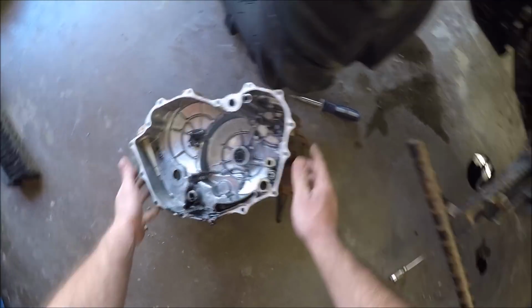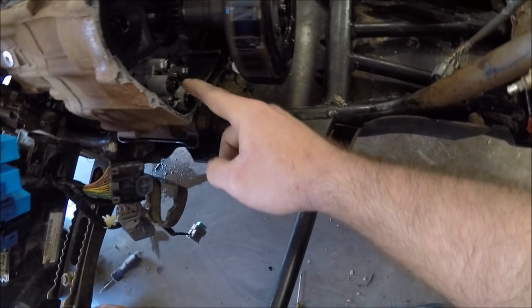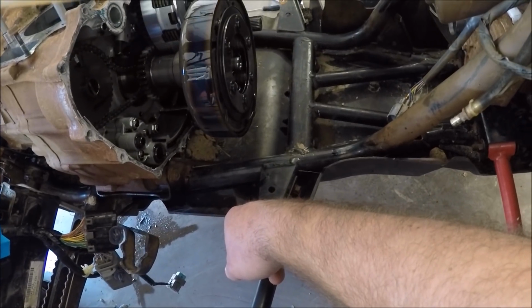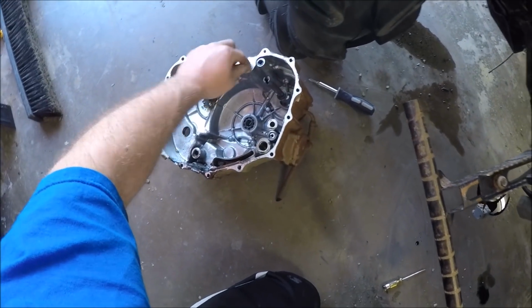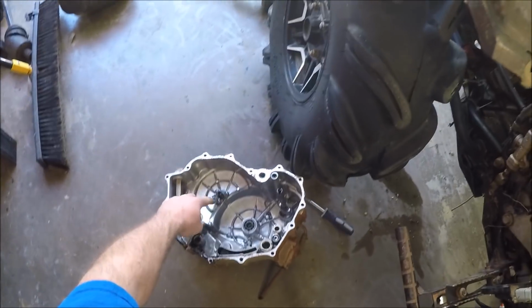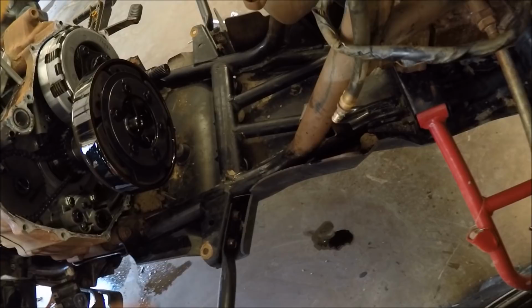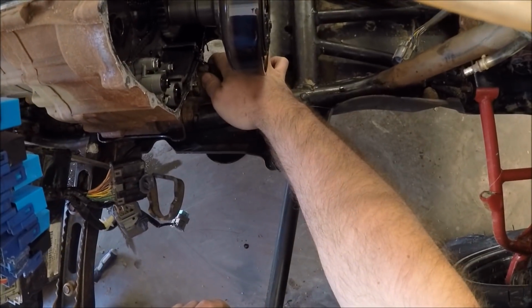as far as washers and the whole clutch assembly piece over there. So we're just going to check for O-rings and dowels real quick. Got an O-ring and dowel right there, O-ring and dowel right there. Should be an O-ring up here. His ball and spring stayed on there. First thing I got to do, get rid of this.